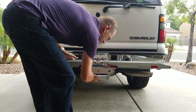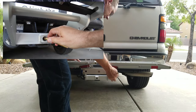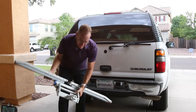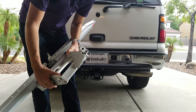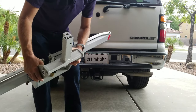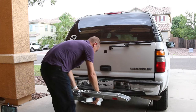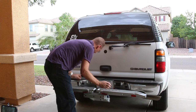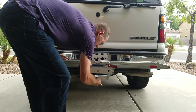It is attached to the vehicle with a simple security Allen key that they give you. It can go into a two inch or inch and a quarter mount for your rack. It comes with an Allen key to adjust that and take off the adapter. You want to insert at least two inches in there, then simply tighten it up using the provided security Allen key.